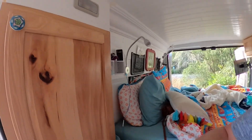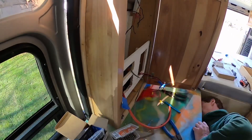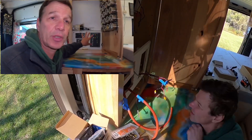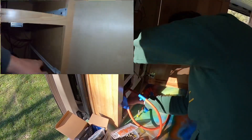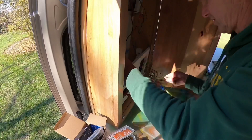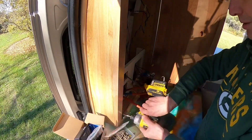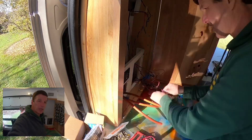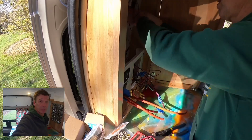This was Terry's brilliant idea - putting this cabinet in and shaving the back off. What I really like about this setup is the ease of wiring between the top panel, underneath the cabinets, and the inverter and battery are right behind this wall. That makes upgrades and general wiring so easy. The total time to wire all the AC and DC was about two hours, which is really nice having it all in the same vicinity.